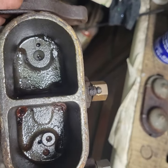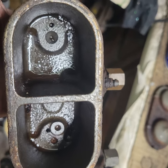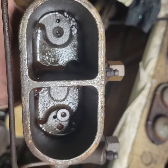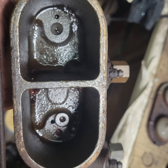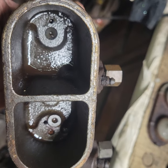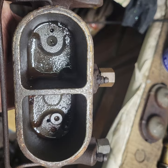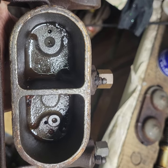Now I'm going to use a piece of wire — almost a welding wire, around 30 to 35 thousandths of an inch — to clear out all of the valves in both reservoirs, front and rear: the feed valve, which puts fluid into the chamber, and the compensator valve, the tinier one next to it, which allows brake fluid to expand as it gets hot.